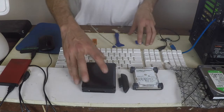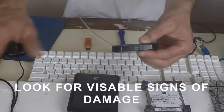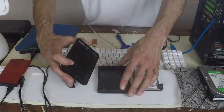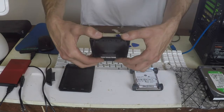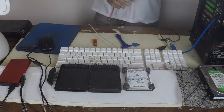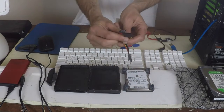In today's example, I was given this hard drive by a friend and the first thing I noticed was that the USB connection had been damaged. So after testing the cable I moved on — I used my iPhone tools which were able to open the case without damaging it. This is a Seagate Free Agent GoFlex drive and it contains a 2.5-inch one terabyte hard drive. Once I removed that — once again, I only suggest you do this if you are trained or the data on it isn't important.